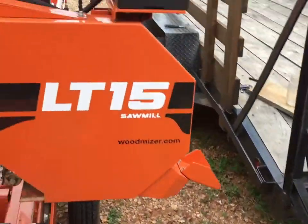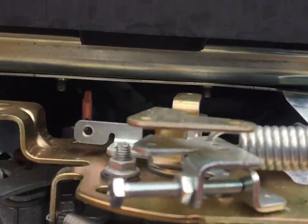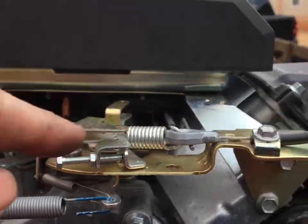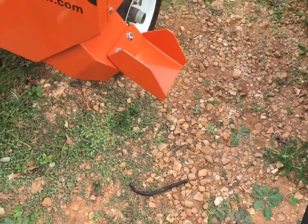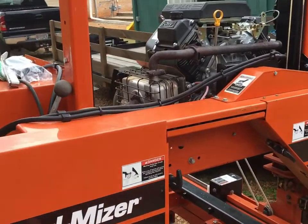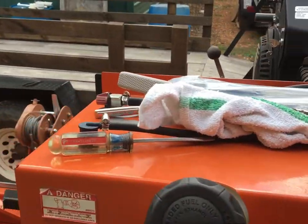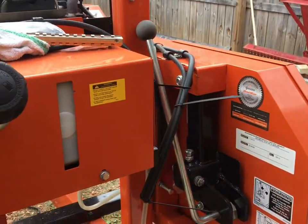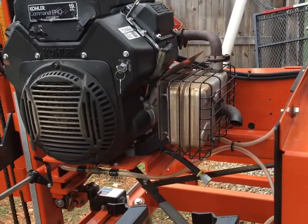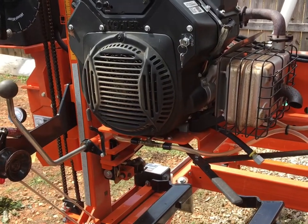While I had everything off — take the air filter off, and then this is the plate sitting on top of the carb — the hose coming from the carb to the fuel pump, while I had all that off, I went ahead and replaced that as well, because I'm sure all this line has been on here about the same amount of time. So I've got everything fuel line-wise replaced all the way from the carburetor back to the fuel tank. Hopefully if somebody's got the same situation as this, this video will help them self-diagnose it. It's a simple fix if you've got a little bit of mechanical skill, and hopefully it can save you three to four hundred bucks or more in labor.